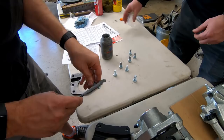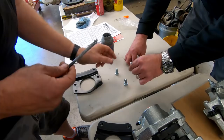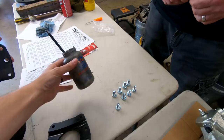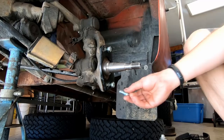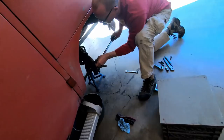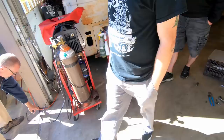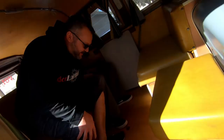Alright, so right now we're going to go ahead and put the silver paste on there — a dab will do you. These four bolts go into the brackets that we painted black. The instructions say 36 foot-pounds, so that's what we're doing. Follow the instructions, Matt Jackson! We got the brackets on and now it's time to accomplish lunch.